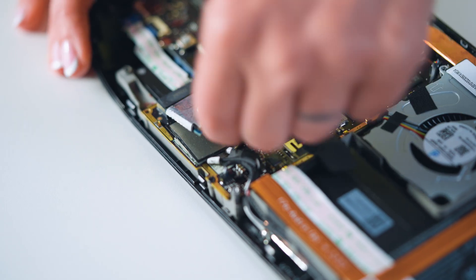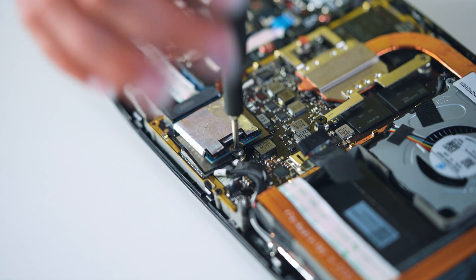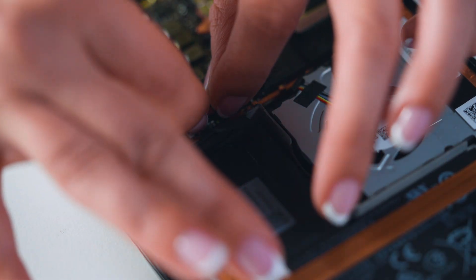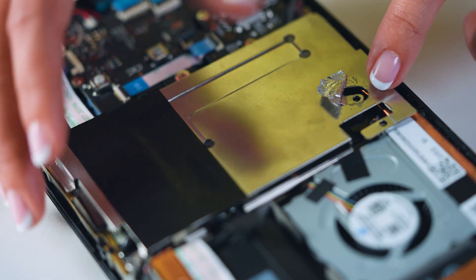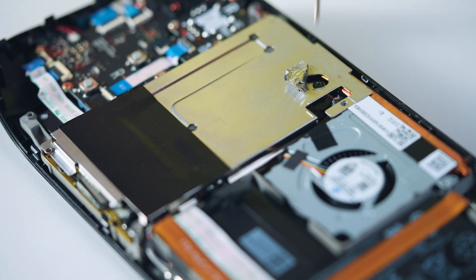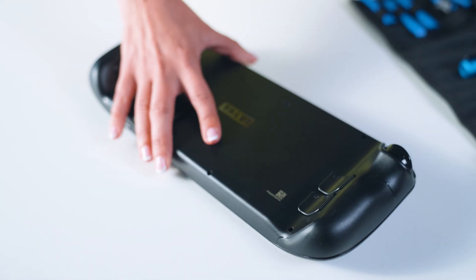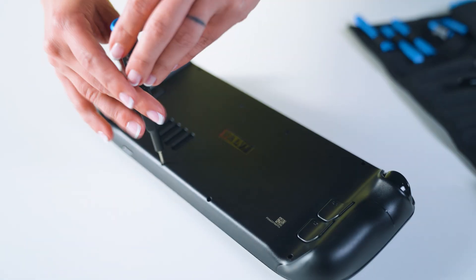Fully insert the new drive into the SSD slot, gently press it down into place, and screw in the correct screw. Putting the Steam Deck back together is what we just did in reverse: gently insert the battery cord tab to reattach the battery, put the motherboard shield back with the tabs in place, screw it back in using the correct screws, and if it's there, flatten out the foil tape over the third screw. Reattach the Steam Deck's back plate, which should snap into place ready for screws — short ones on the inside, longer ones around the perimeter.